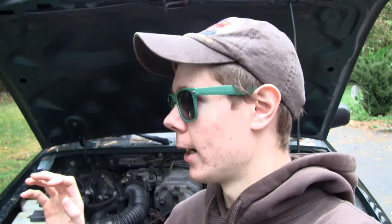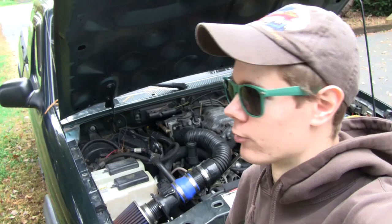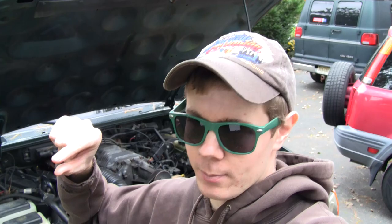If the ECU isn't getting a signal or is getting an incorrect signal from the temperature sensor, it's not going to set the correct mixture — which is exactly the problem I'm having. Pretty much anytime I start the vehicle it's difficult; once it's running it's alright, but it's all in the start. At this point I'm betting on either the cooling temperature sensor itself being bad, or a problem somewhere in the signal path from the sensor to the ECU.